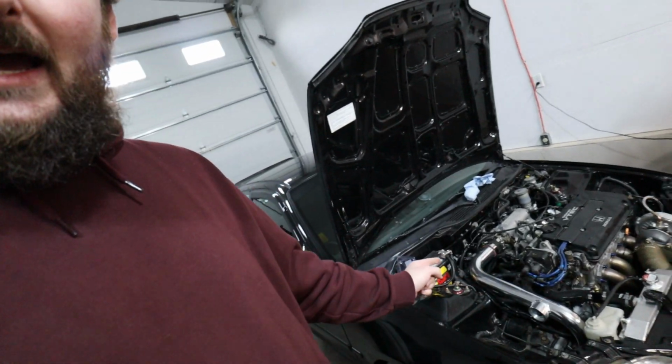I'm gonna call up my fabricator and I'm either A, going to get him to make a new 2.5 inch cold pipe right there, or I'm gonna get him to cut out that circle in aluminum with a hole saw that doesn't have a pilot hole through the middle and weld it in place instead of silicone, because with silicone there's always that scare of a little piece falling off in there, getting sucked into your engine, yada yada yada. I've had it happen on oil pans quite a few times.